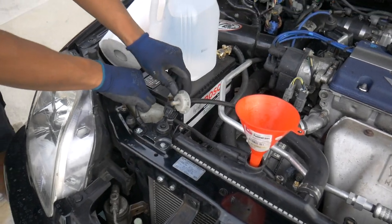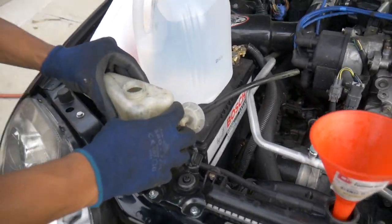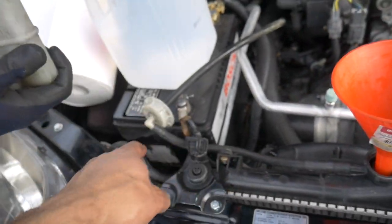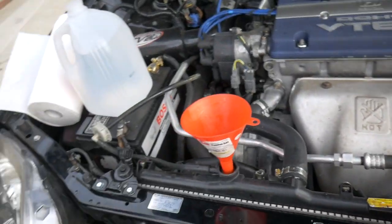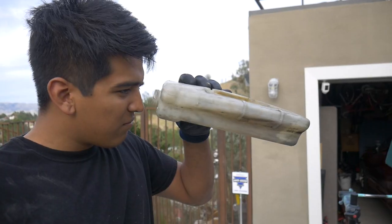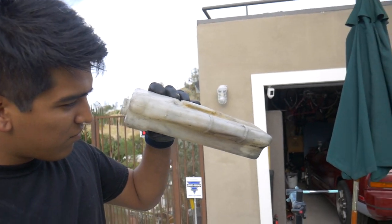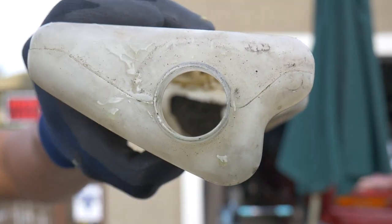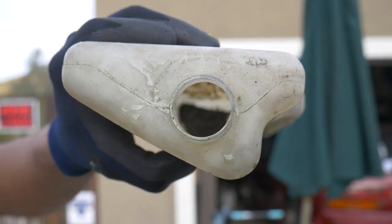In Matthew's case he does have an overflow tank. It's really easy to find — normally if you look at your radiator cap there's usually a hose running off of it, and then either to one side of the engine depending on the car. Just take that and literally dump it out, then hose it out again just like we did with the radiator. You probably have a lot of crud collected in there.